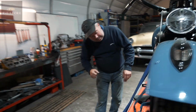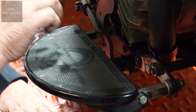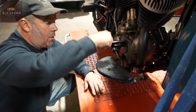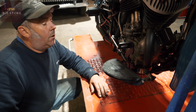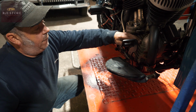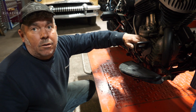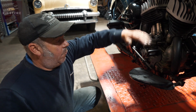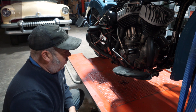The outlet's here. There's a little tube that goes straight up into there, like an oval tube, and that lets the crankcase lower pressure come out through there. Sometimes you can hear it hiss when you kick them over. But if that's full up to over that level, you're compressing everything that's in the bottom end of the engine, because the rings act the same going down as they do going up. So you're going to compress the lower crankcase, and it won't do it any good at all.